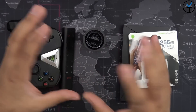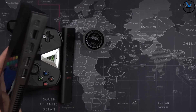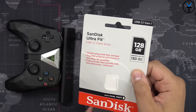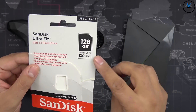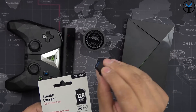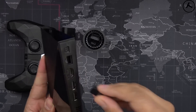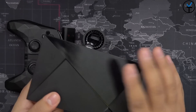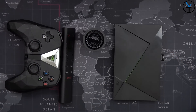Once it's hooked up and set up with your entertainment system, I'll show you how to load things on this unit without needing USB ports. For the NVIDIA Shield TV Pro, we have two USB ports. For that we're using the SanDisk Ultra Fit — a USB 3.1 128 gigabyte drive with up to 130 megabytes per second read speed. You need fast read and write to access it properly. It's very minimalistic, doesn't take much space, and we're going to convert both of these to adoptable storage.